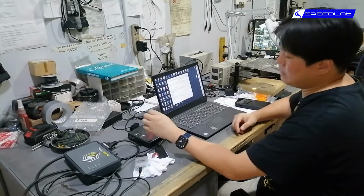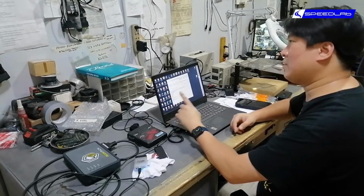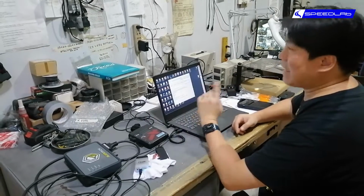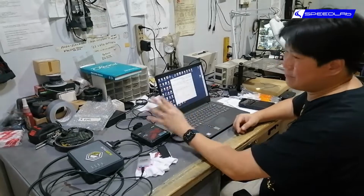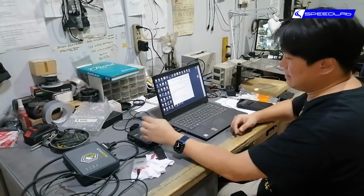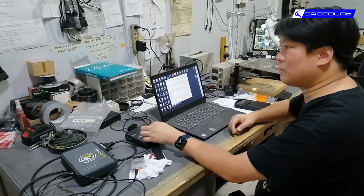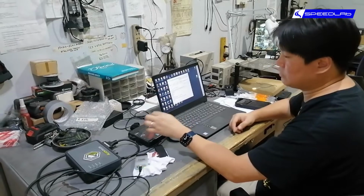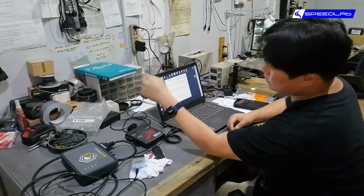And the other thing we can change with this one is the ignition timing. By ignition timing, we mean when the spark plug fires in relation to the cylinder. It's not cam timing, it's not crankshaft timing, camshaft timing. No, it's ignition timing, when the spark plug fires. The BMW doesn't have a distributor. I think this one doesn't have a distributor anymore. It's not exactly a direct coil pack, but it's electronically controlled. So the ECU tells the spark plug to fire at so and so degrees.